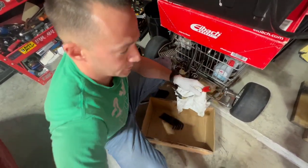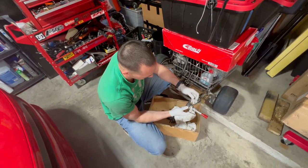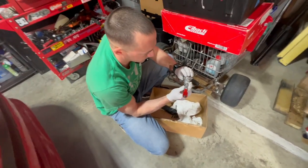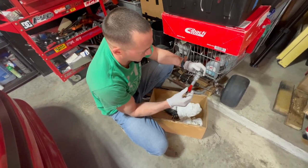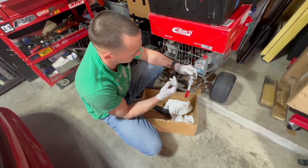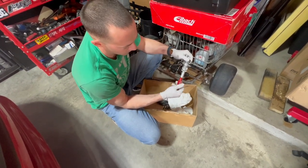This is the vehicle speed sensor. Ours has a kind of janky broken clip — it's been soldered together. Last time it was just finger-twisted or whatever. All you have to do is put the pins in and spin it by hand, but what I'm going to do is take the gear off, put it on a drill bit, and spin it a little faster to see if we can get some voltage out of it. Essentially it acts like a small generator, sending little on/off voltage pulses.